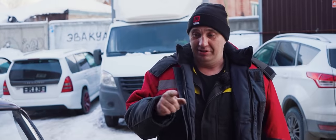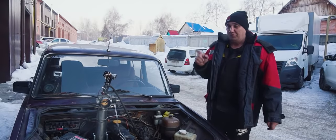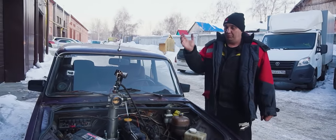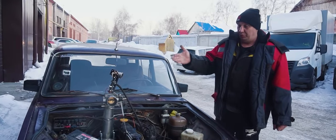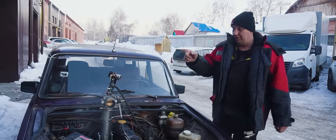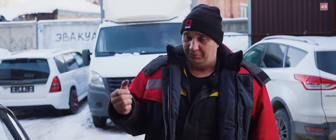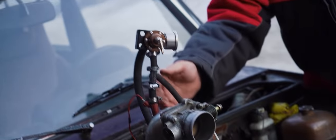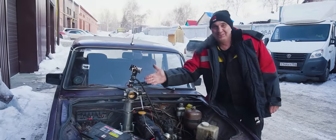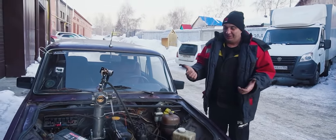And so if you decide to go this route, first of all, you're better off using a smaller throttle body. This one really is a bit too big. Then you have this injector, you run a fuel pump, a fuel pressure regulator, and in order to be able to dial in the right pressure and make corrections in the process of doing so, the regulator has to have a pressure gauge, or you could plumb that in separately. The drawback to that being, of course, just look at this complicated mess consisting of clamps and hoses. I mean, it is really hard to make any sense of this. Anyway, ultimately, we were able to put something together.